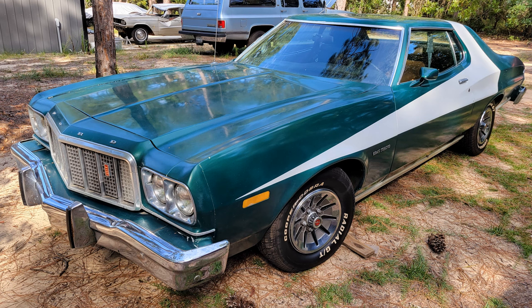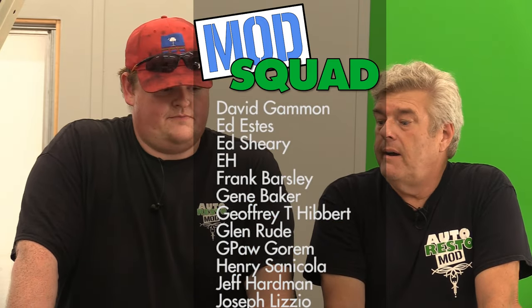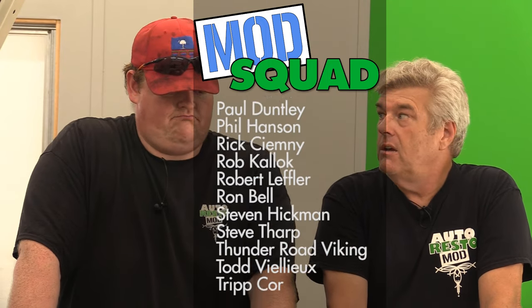I like the EnviroSafe. I'm excited to get some new O-rings and put them on the Gran Torino to get the AC running. For a 134 replacement, it's really good. Sitting in here on an 80-degree day, we're getting 43 degrees out of the registers. One can fills the system - it's less than a regular can of 134 at about $15 a can. I think it's something like 8 ounces equal to 21 ounces of regular 134 - about a three-to-one ratio. I'm going to put it in the Gran Torino and probably get some more for the other cars - we've got to put AC in Logan's Ranchero and the '64 Falcon we're moving over.